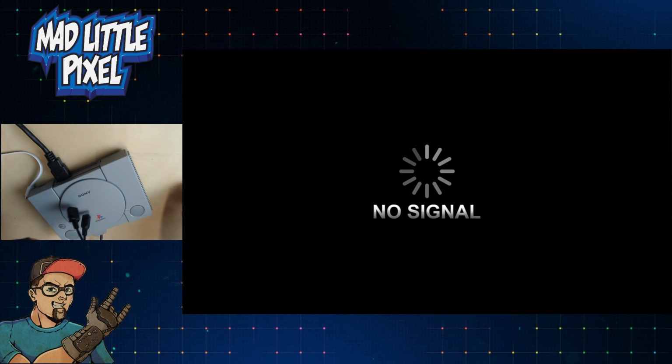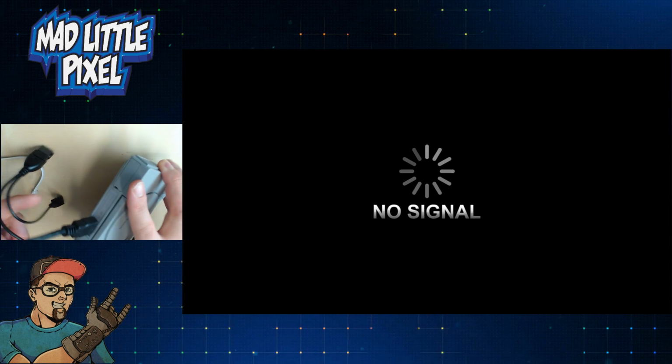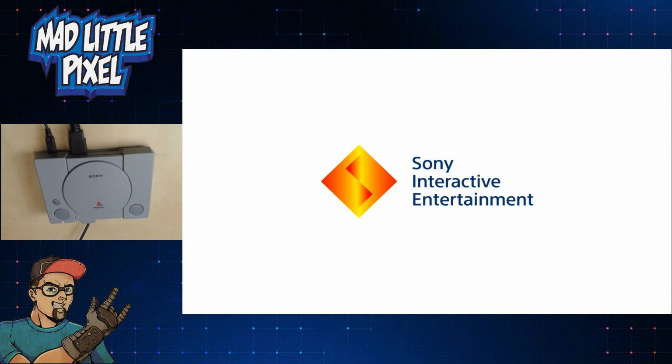So let's go ahead, unplug our power supply, remove the USB drive. We're going to plug in our OTG adapter. First, I'm going to plug in my Samsung drive that does have the AutoBleem build on it. We have the drive in there. We have our power end, plugging it into the PlayStation Classic. And then our actual power cable, we will plug it in as such. Give it a second for our light to turn orange, and then go ahead and hit power. If everything went as planned, we should be booted up straight into AutoBleem, no problem.